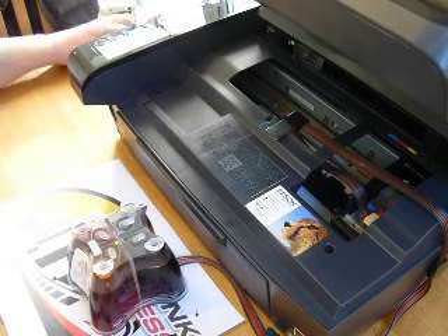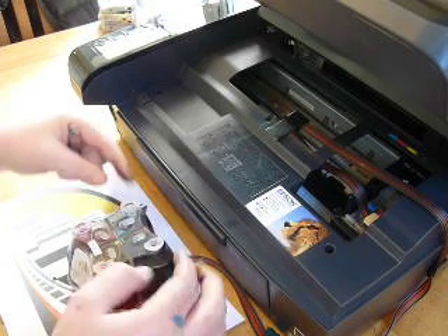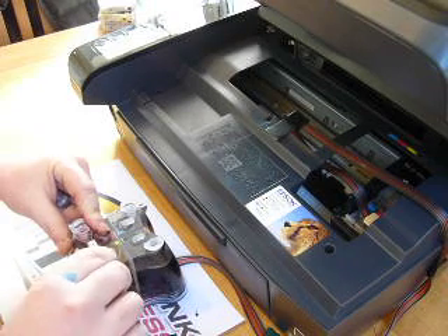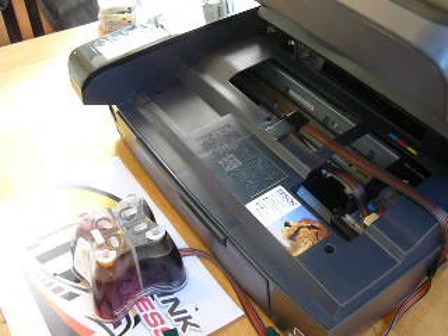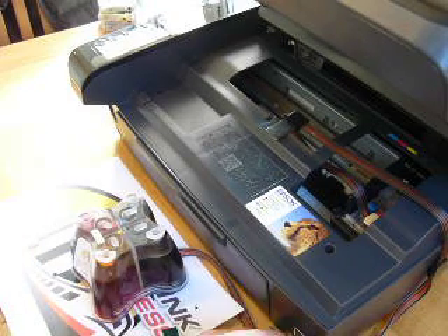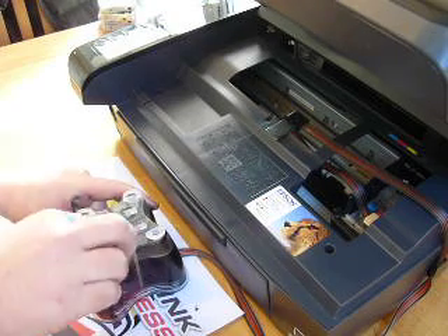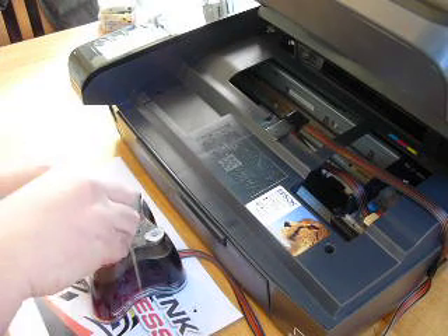One of the next things we need to do is the air filter — that part of the installation is now complete. On top of the continuous ink system for this model there are eight plugs. The large plugs are your refill holes: to refill the system you just take the plug out and either use a syringe with your bottle of ink or basically pour it in. It's very important that the continuous ink system is sat at the same level as the base of the printer. It mustn't be on a shelf above or raised in any way — they work on gravity, and if it's raised in the air it will flood your printer. These four inner plugs are the air balance chambers; we need to remove the four small plugs and install the air filters, which will allow the ink to flow.